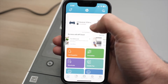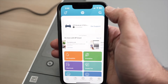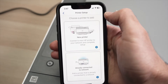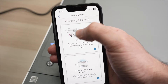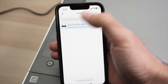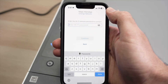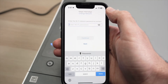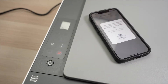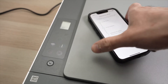We need to add the printer. Press on the top right corner symbol — a printer with a plus sign. Then press on New Printer, the top option, and select the printer that will appear on the list. We now have to enter the Wi-Fi password of your home or office network. They ask us to press the I button on the printer — press on it once so the setup continues on the screen.